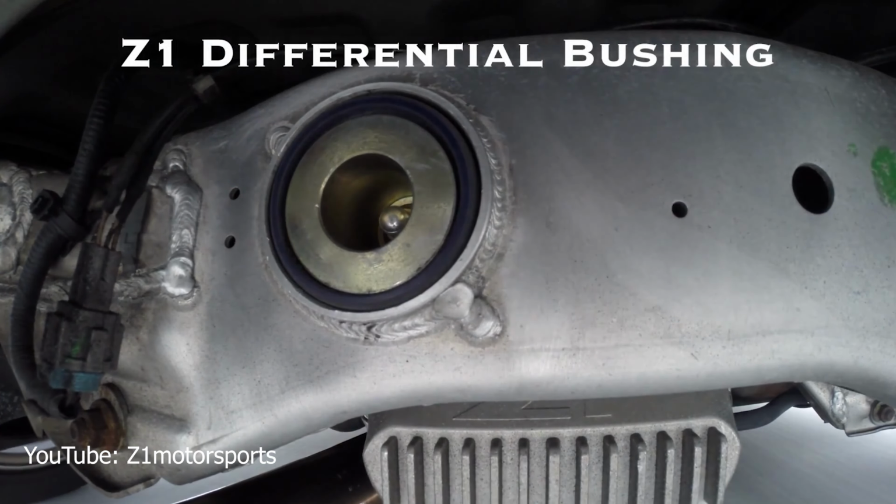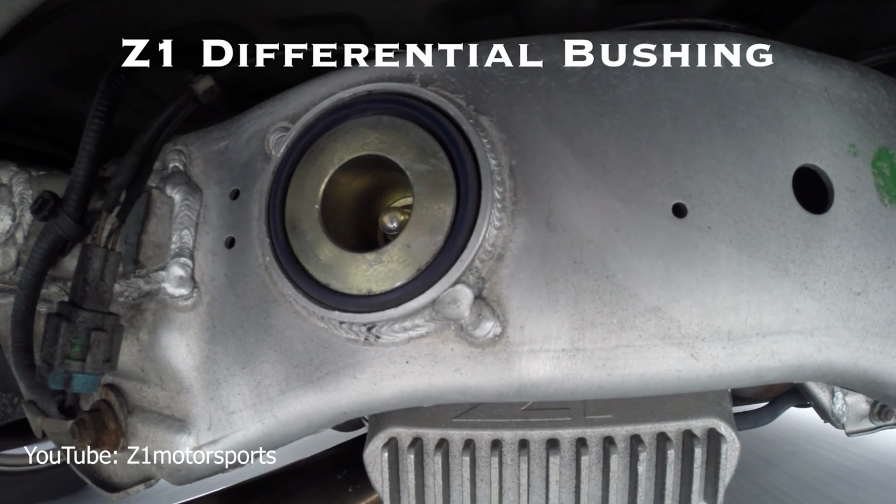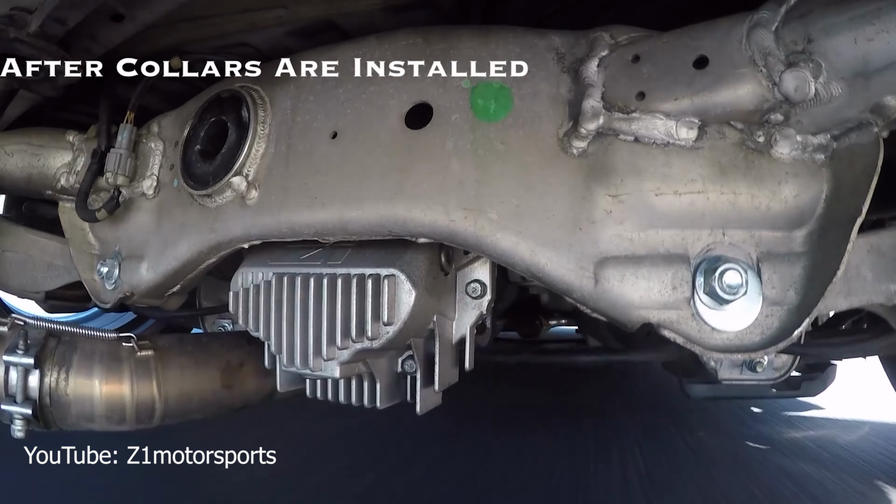I'll show the before and after of the subframe collars being installed on a G35, and it'll show how much play each one has. So you can see right here, the subframe moves even if you have a differential bushing on the car. Once you install the collars with a polyurethane bushing on the differential, you get little to no play.